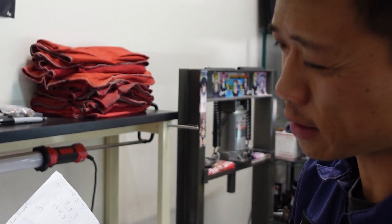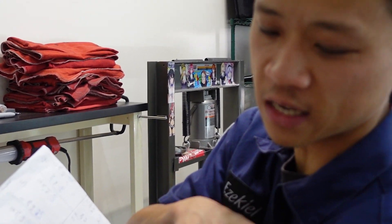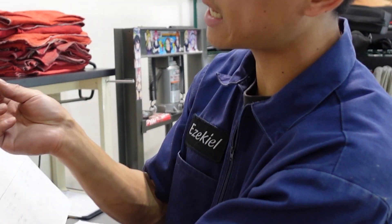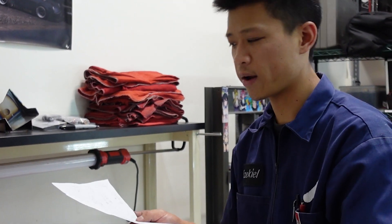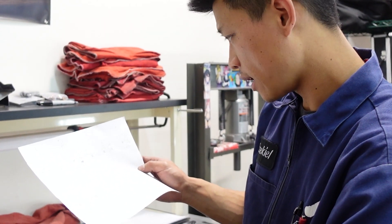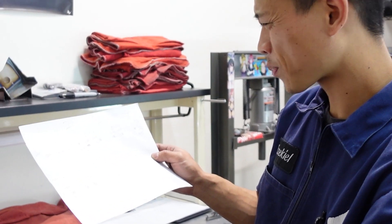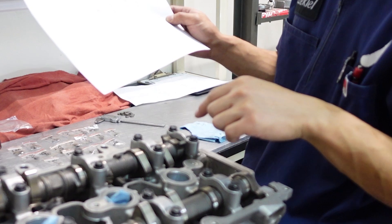If I wanted, I could get a little closer to the middle of the spec, but the fact that my 0.27 feeler gauge did not fit in here means this is for sure within spec. Again, this is like my third round of valve adjustments — so this guy I loosened up, I put a smaller shim in there to increase the valve clearance. And it looks like my other two that I need to check are cylinder 3 number 1, and then cylinder 4 number 2.